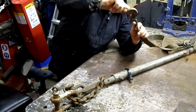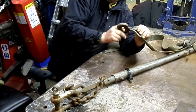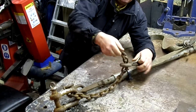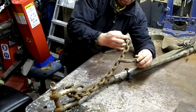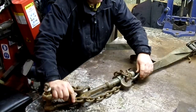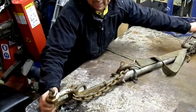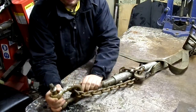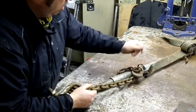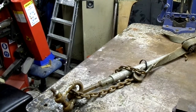I welded on a hook - because I used to do a lot of jig work and body work, I cut the hook off and welded it onto the end of a ratchet strap. This hook will lock onto a chain, which itself locks onto the links. So that'll go - pull tight. Put the D-ring toward the star. Pull the chain out tight, onto the D-ring, so it's nice and snug. That's doing the forward pull. The bar is stopping the car coming forward.